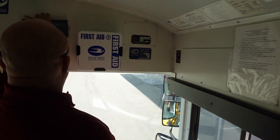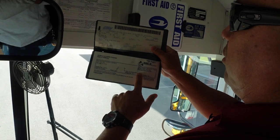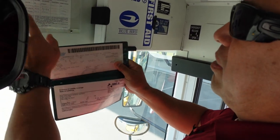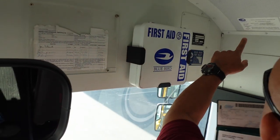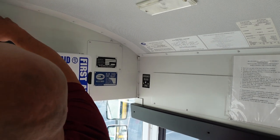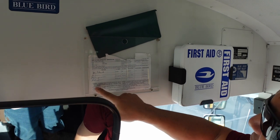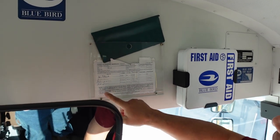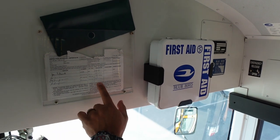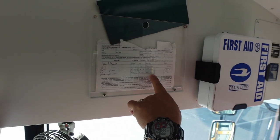Next, I'll go to my documentation, making sure that my registration and insurance is current, and making sure that my VIN number and my license plate number match the CHP 292. The VIN number also matches my bus plate. This is a 2017 Bluebird owned by the Delano Union School District. It's a 78-passenger bus, which makes it a type 1 bus. The CHP 292 inspection approval certificate is inspected every 13 months; last inspected was June 8, 2020.